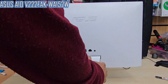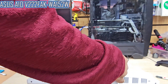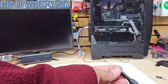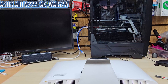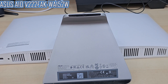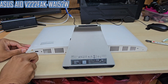First of all, check the model number because sometimes ASUS All-in-One PCs look similar but have different disassembly strategies. Make sure the model number matches, especially the first seven digits. For example, this one is V222FAK — Victor, double-two, Freddie Alpha Kilo. The last six digits don't need to match. This unit came out in 2024 but still has a 2.5-inch hard drive instead of an SSD.